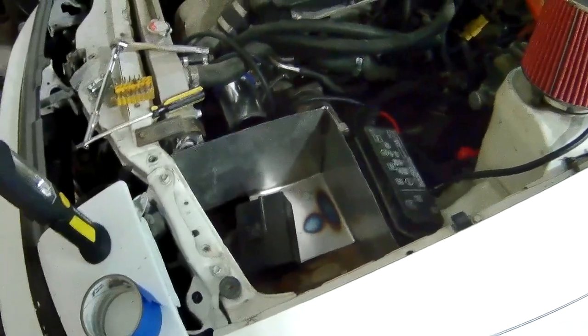So here's a little more progress. I had put this extra lip in before for this bolt hole, and due to the fact I couldn't get a solid 90 degree bend with no curvature, it's pushing this too far out. So I just cut it off. What I'll do is take that metal, cut off a little bracket to weld on about where this bolt goes, and just drill a hole through that bracket and boom, done. So yay, it's pretty solid in here though, let's be honest.